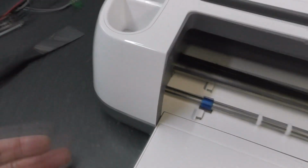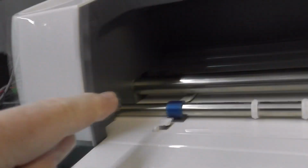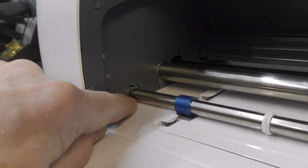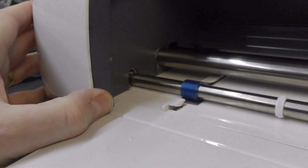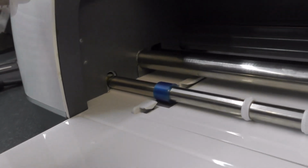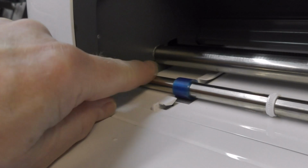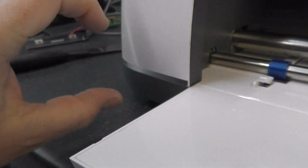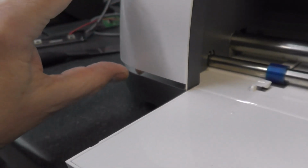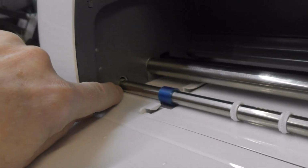It is straightforward. There's a motor that unscrews this end, pull the gear out slightly, there's a little circlip holding that shaft in place, and without taking the plastic gear fully off, and anyone that's done this will know what I mean, you can actually get a flat bladed screwdriver in there, and you can pop the little circlip off the end of this shaft. The plastic gear is quite a large one and it won't come off because there is a metal bracket fouling it, so you don't have to dismantle the whole lot. Take the motor off, a couple of springs to release, pop the circlip off.